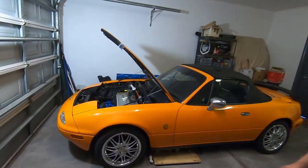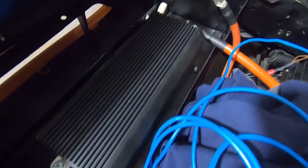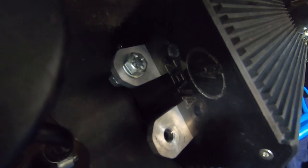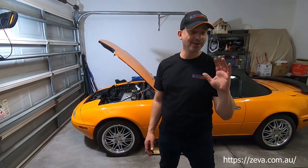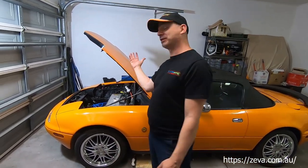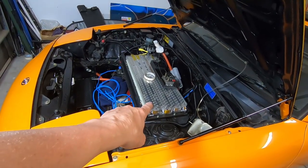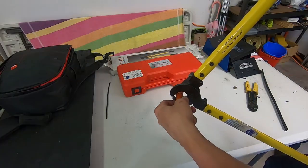So what's the next plan? We've bought a new controller. We've gone from 600 amps to 1000 amps. That's a Zeeva 1000C. I bought this controller from a guy from Perth. He's a wonderful guy and he's a really talented engineer. He recommended I go for the 1000 amp, and he came to the party and gave us one almost at cost. So all that's got to come out. We've just got to reconfigure some wiring. Don't try this at home.